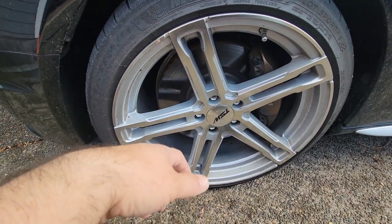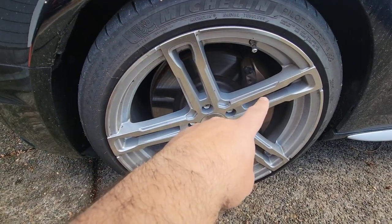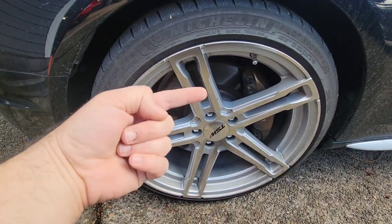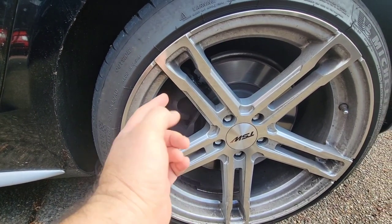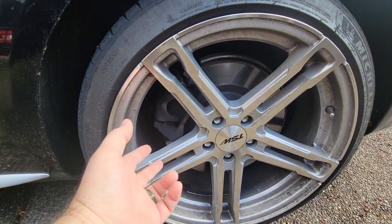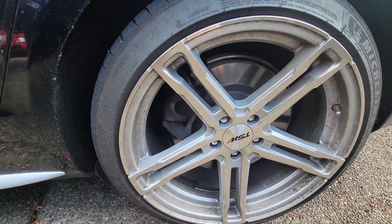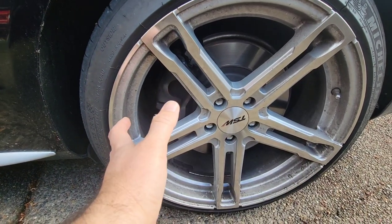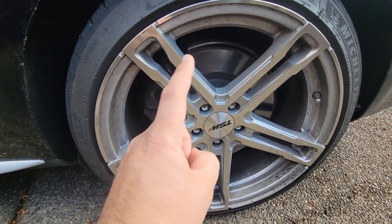You can see the rotors are still kind of a blue color — they don't have the heat capacity to keep up with this car even at autocross, let alone track events. So we're changing the rotors today, changing the pads today, bleeding the brakes today, and doing the same on the rear. The rear is a single piston sliding caliper, but upgrading it is really difficult because of the electronic parking brake.